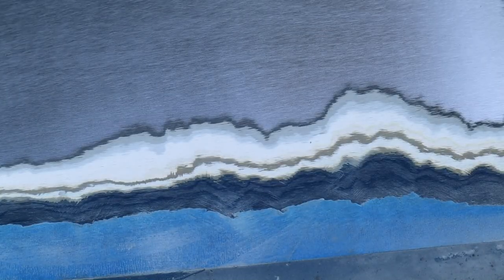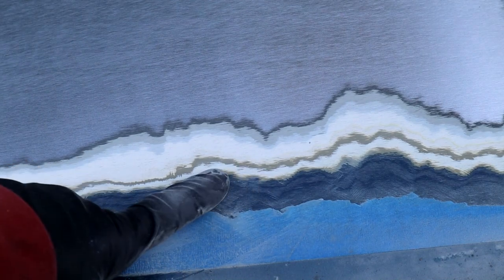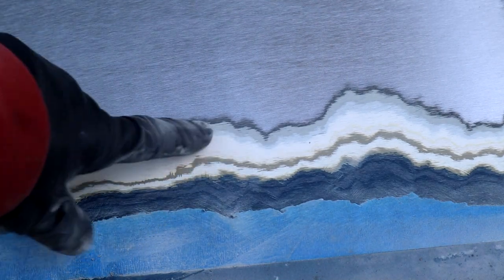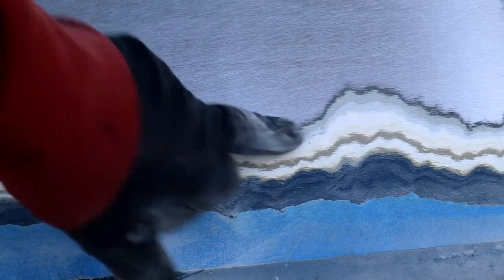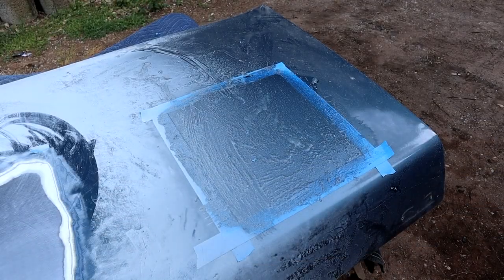So you can see the blue is the paint, then what looks like primer, maybe some filler, then the white 050 white, then primer and maybe some other product — you can see that gray line there. You can feel the ridge — it's an incredible amount of paint. I think whoever painted this had shares in a paint company. It's going to be a graft to get all that paint off, but the SCT definitely seems the way to go — bloody noisy.